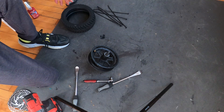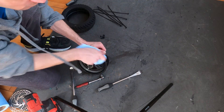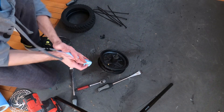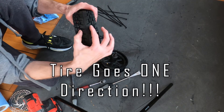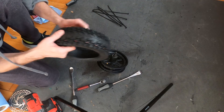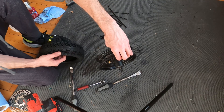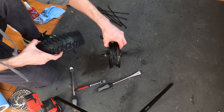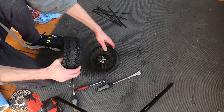Now we have the tire out of the way. It's not as bad as normal tire slime. The tire is directional — you can see how it has arrows pointing forward, that's the direction it spins. Always make sure when you install it that it's properly oriented. With the scooter in front of you and the rotor on your left-hand side, that's how you want to put the tire on.